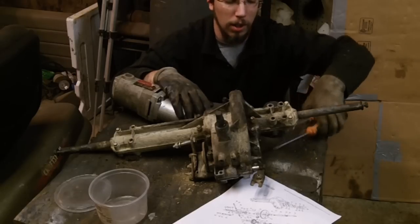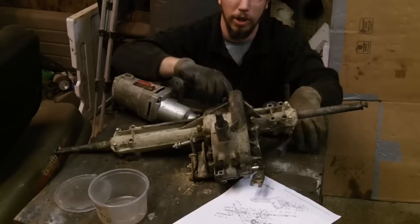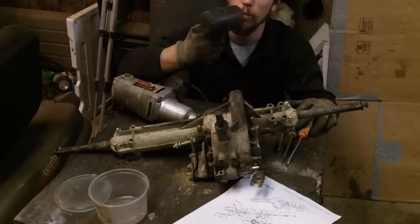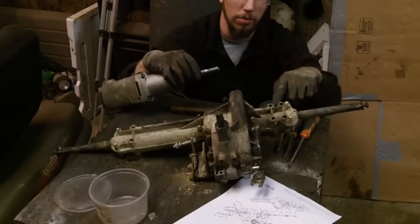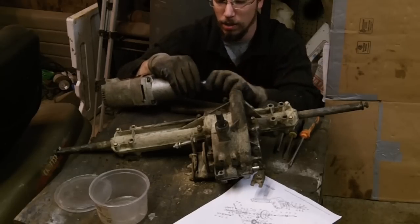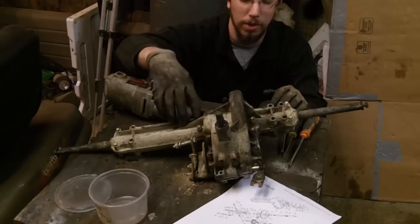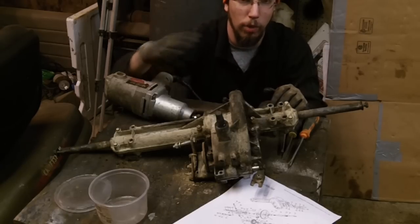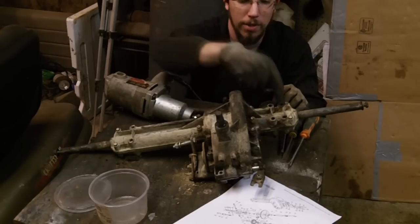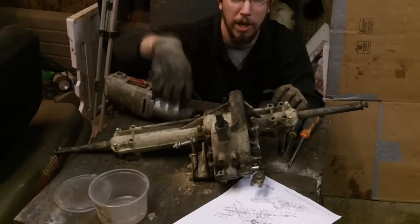The other thing you're going to need, assortment of flatheads, because you're going to have a seal you're going to have to break out, a rubber mallet in order to hit that seal. In the case of this MTD transaxle, it is a 3/8 nut that it uses, 3/8 bolt that it uses all the way around. I use an electric impact, but what I do is I put a couple of hits onto every single one until they start to break out, going a crisscross pattern.